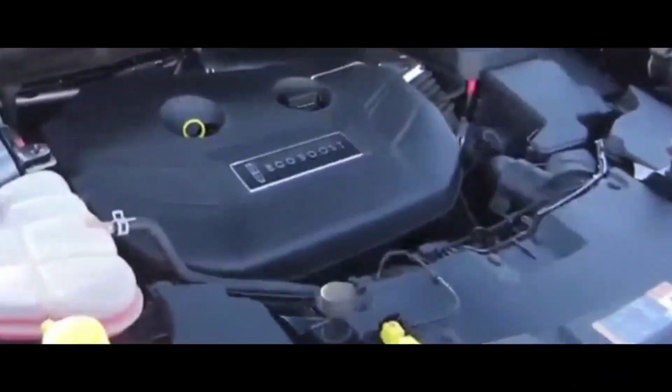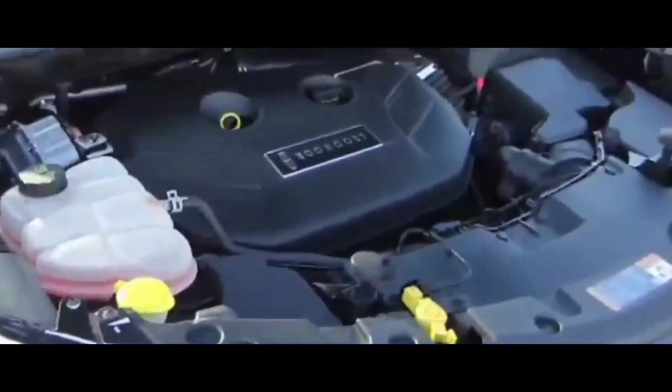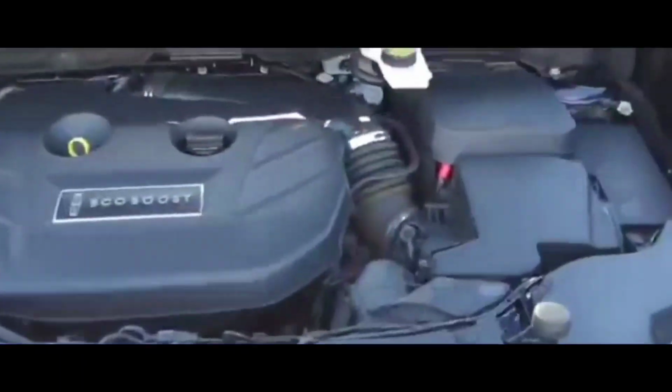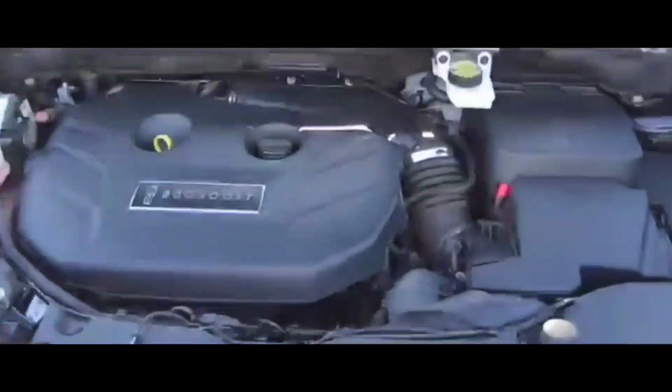And you can analyze the fault codes the ECM throws with an OBD2 scanner. You can get one from $19 at Walmart. These codes will guide you towards the root of the problem, and you can begin replacing parts to try to fix the issue.